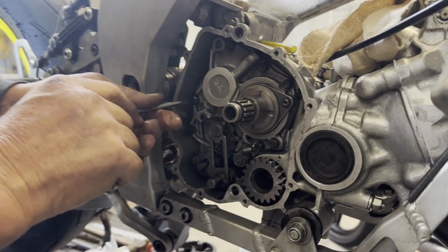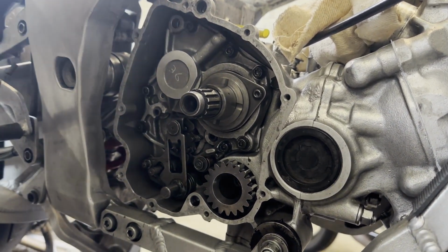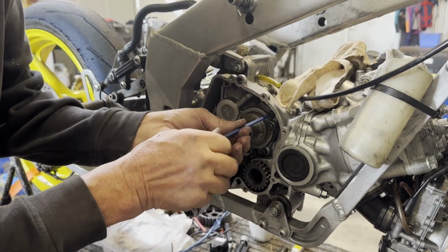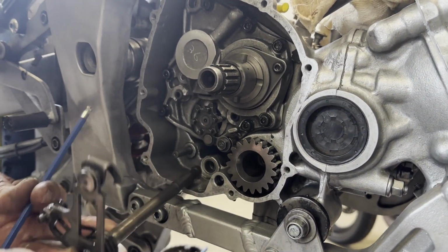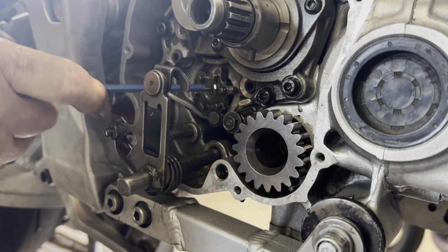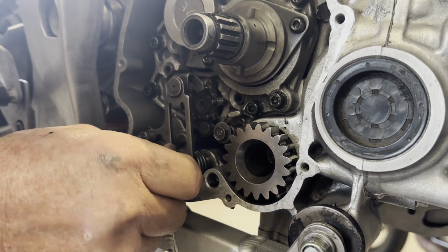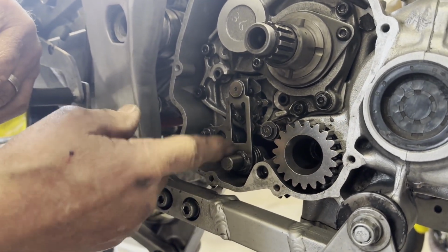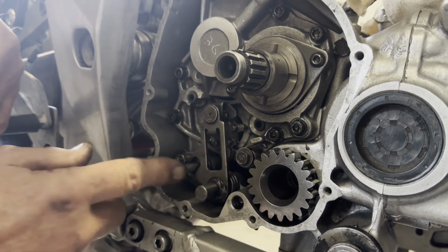The counter shaft goes out through a bearing, and the clutch shaft lines up through the shaft and a position for that. And then the gear shaft just slides in position, and the selector picks up on each of these little pins, moving the gearbox down in the gears or up through the gears. And that's adjusted on here. There's an adjustment here, which we don't really alter once it's set. It just positions this in the centre of those pickup pins, so that stays pretty well.